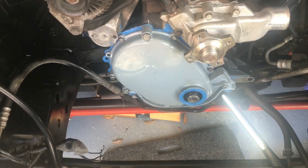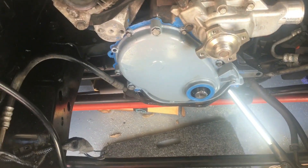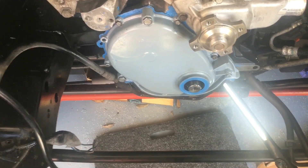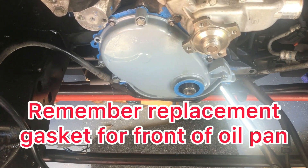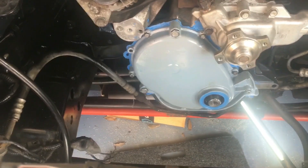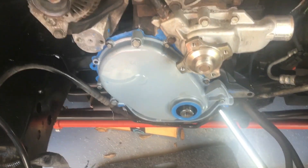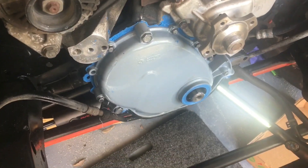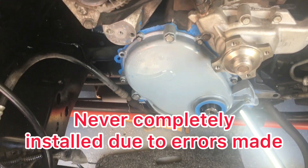My Jeep update — it's about 1 o'clock in the afternoon. I got the timing cover on, but now I've got to start a hunt. I dropped one of the bolts that go to the timing cover and I'm still looking for it. I got the rest of them snug up on the gaskets and the RTV. Next thing I've got to do is install the harmonic balancer to straighten and center everything up.